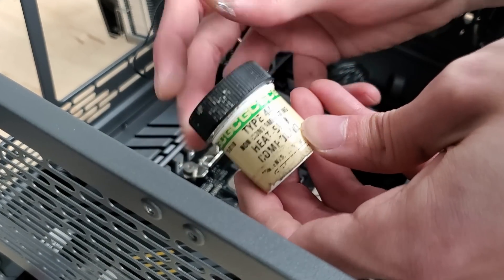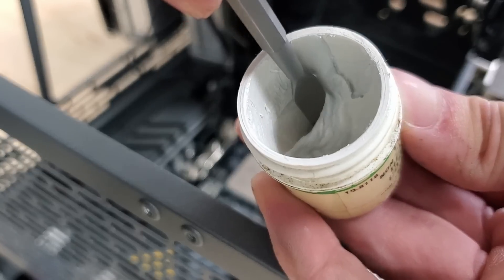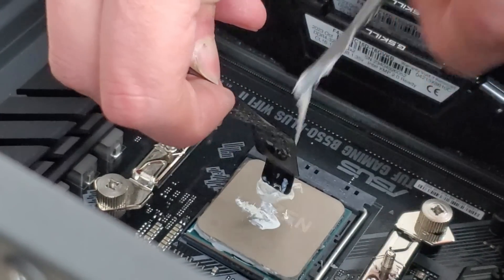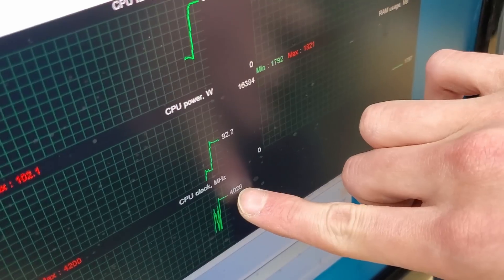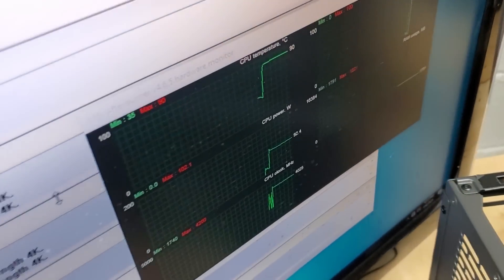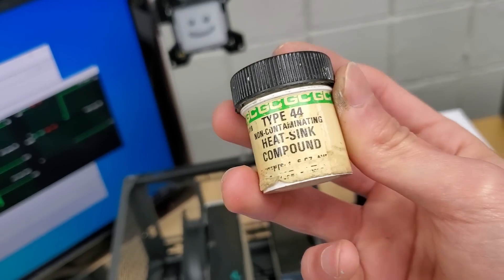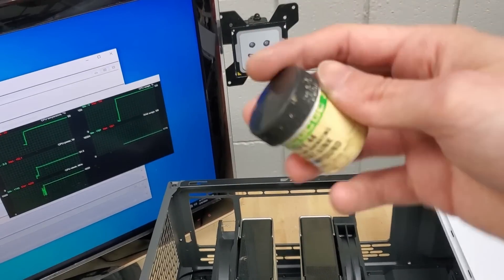Just for fun — what happens if you use a 30-plus-year-old tub of thermal paste? Surely there's no way this can still be effective. Check out how dry this is — there's almost no oil left at all. We'll add that same pea-sized amount onto our CPU, if it'll even come off the applicator. This is not going to spread well at all. The temperature does hit 90 degrees and clock speeds drop from 4.2 GHz down to basically 4.0 GHz. I suppose that should be expected, but this is still on paper an effective way to transfer heat. I did reach out to GC Electronics to try to pinpoint exactly when this tub was produced, but as of filming I haven't heard back — if I do, I'll leave a pinned comment below.